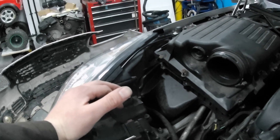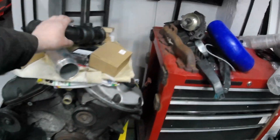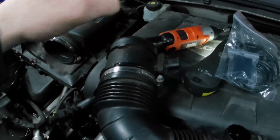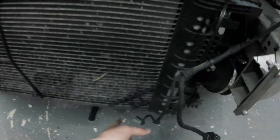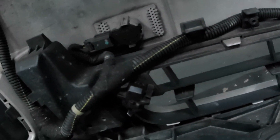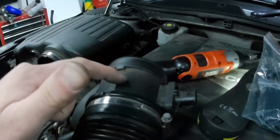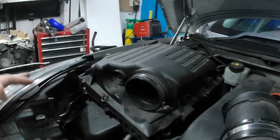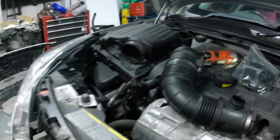I'm going to put it all back together. On the mass air flow meter there is a temperature sensor, I believe. So when I'm doing my datalogs on the OBD reader, I've got air temperature there. And then down here this little plug goes to this sensor, which is my outside air temperature. Typically there is one degree difference between the air going into the turbo and the air at the front of the car, looking at my datalogs. So I'm hoping that with this ram air, the temperature on this will be the same as the temperature at the front of the car. We shall see.